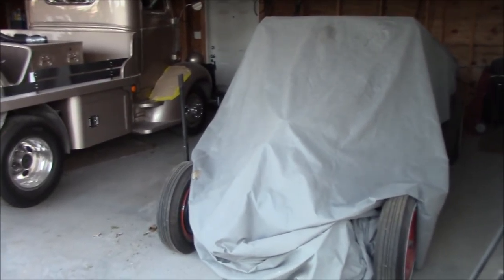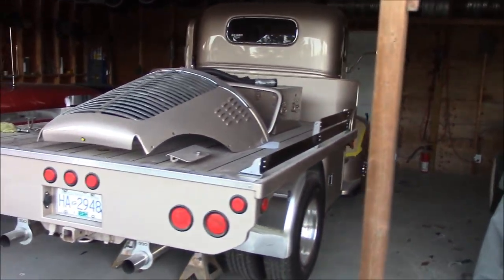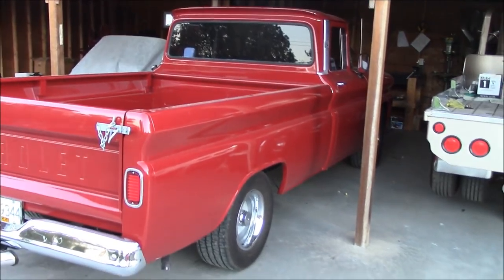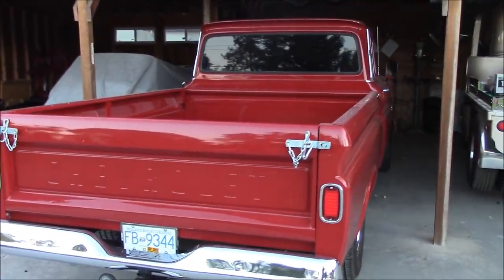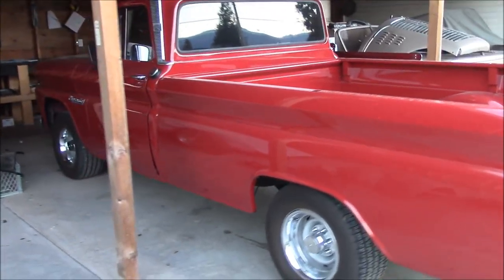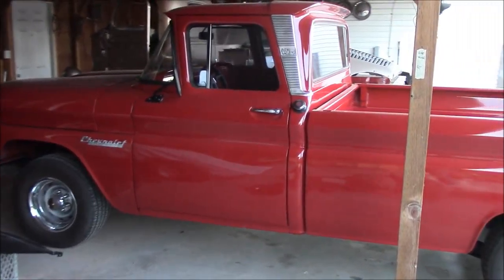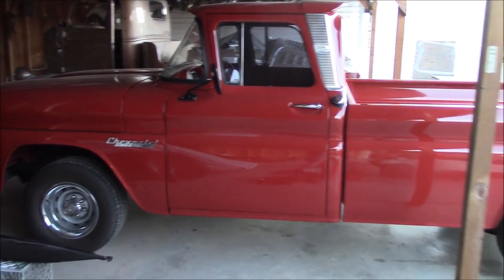We'll take a walk outside. Dan's 37 Ford is still here — we're actually going to be starting on that within the next two weeks. Darren's still working away on the little Chevy cab over, and we're hoping to have that one finished up by the end of this week. You might recognize this truck — it's the 60 Chev pickup that Rich brought us a while back. He had us install a tilt column and do all the wiring on it. He was very happy with our work, because he's come back again. We're going to be installing a power disc brake conversion on the front, with a 2.5 inch drop spindle. We're also going to be pulling his gas tank out — it seems to be vaporing a bit in the cab due to a small leak up by the filler neck.